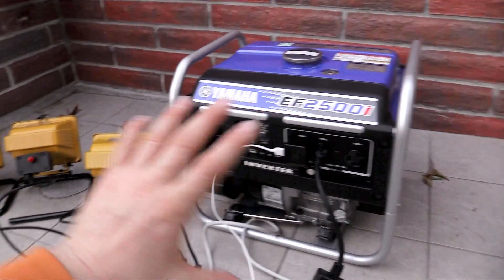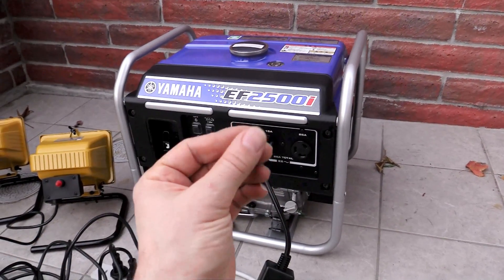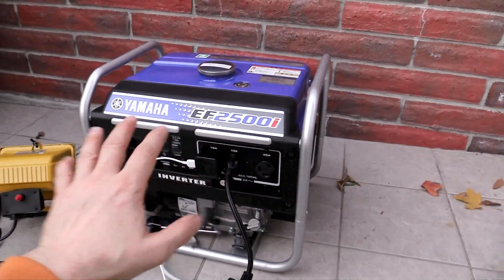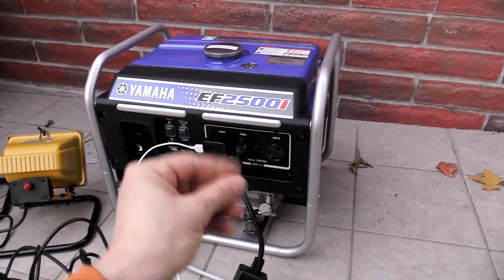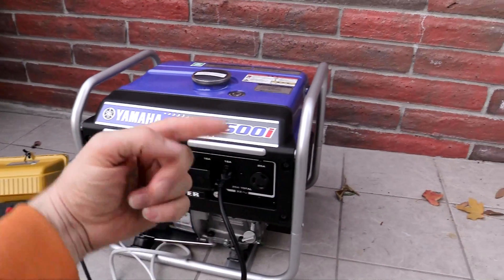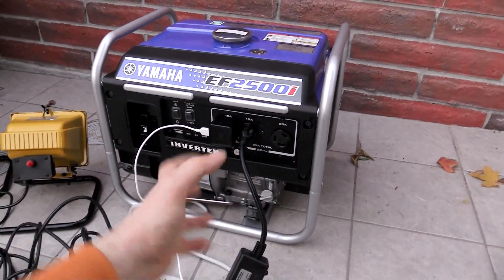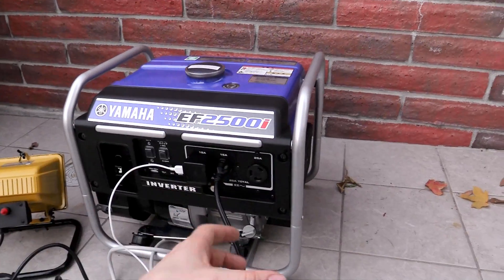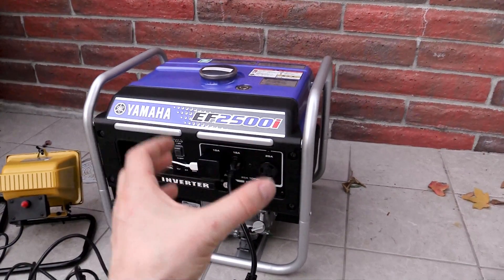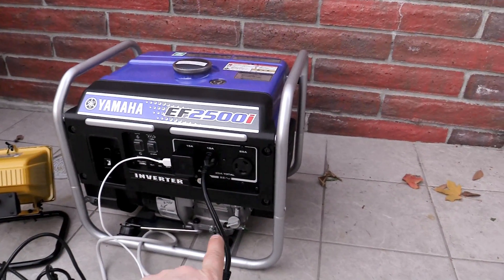So we need to put power on the engine. Why don't we just leave the power on the whole time? Well, you can't do that either. Because as those rings are scraping up and down, they're going to be shaving off microscopic, almost nanoparticle-size metal shavings. If you don't turn the load off, they're just going to build up and cause grinding problems. By turning the load off, you create a vacuum condition in the crankcase, which sucks that oil off, ready for when it loads back up and you start scraping again. It scrapes the bores, then sucks it away, over and over. That way you're going to bed that engine in nice and tight - real powerful, no smoke, no oil being chewed. Perfect.